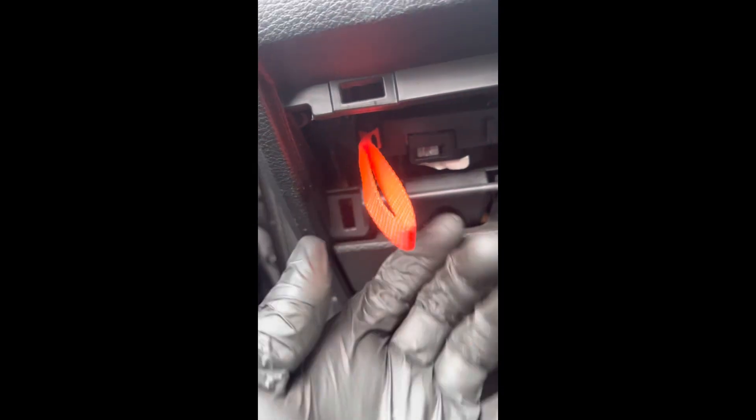...this tab and pull this, and it'll lock it into neutral. Just like a Chrysler 300, it's hidden right here — in every RAM between 2014 to current generation.